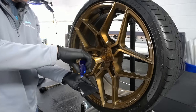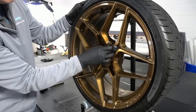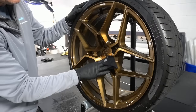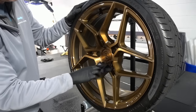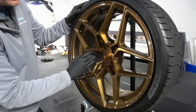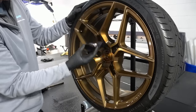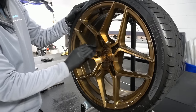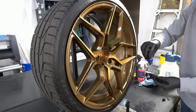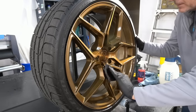If you're comfortable and familiar with coatings, one thick layer will do just fine. Put it on the entire face of the wheel, then wipe it off, flip it over, and repeat that process for the barrel and the back of the spokes, then wipe it off and you're ready to go. No need to rush — even though it is a thicker, more viscous wheel coating, it's still user-friendly and easy to get on there and just as easy to wipe off.